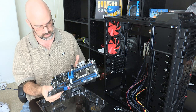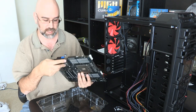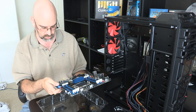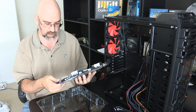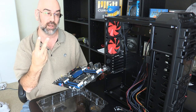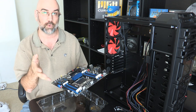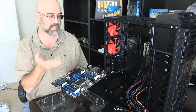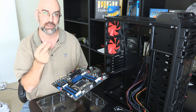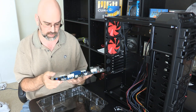Actually, those aren't the USB — these are the hard drives, SATA. It looks like I've got six of them, which is cool. It means I can run six drives in here without having to put in another card. Six drives should be plenty: one for the OS, maybe two if you were to mirror the OS drive. And I could do a RAID setup with five drives for your data drive — that way you could lose two drives and still have all of your data protected. That may be something that I do.